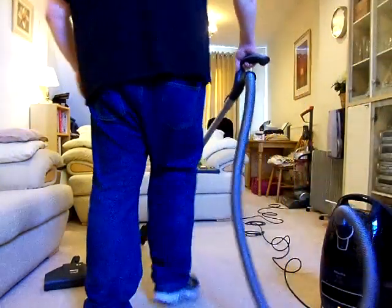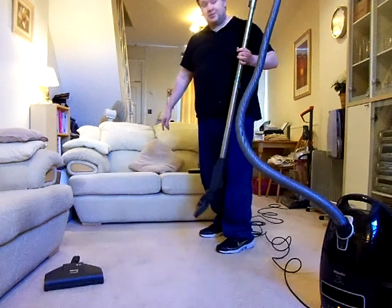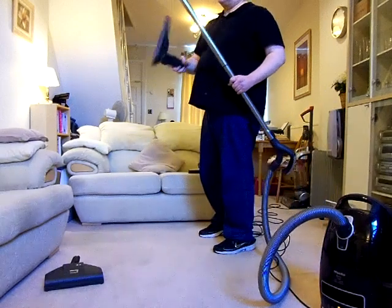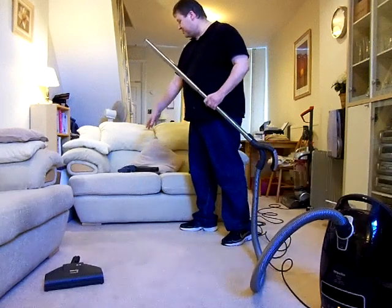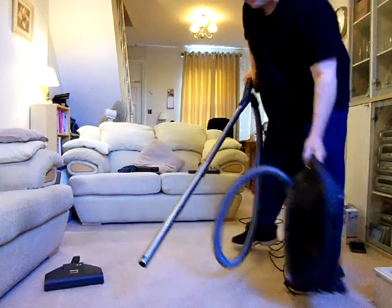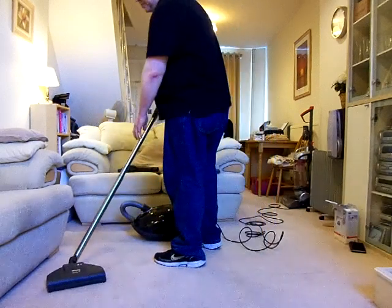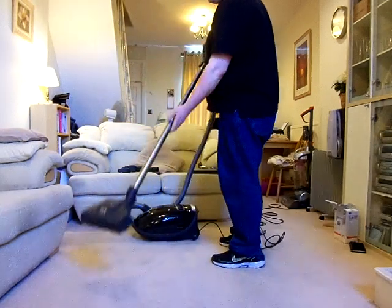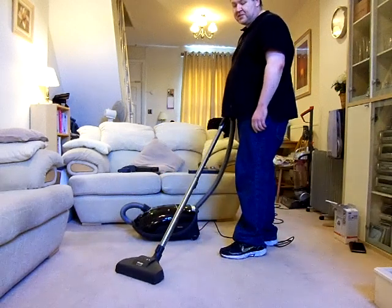That's quite a useful head, but I don't really use it very often because my carpets are always so clean the light would stay on green most of the time. Also, it's not a turbo brush, and I do prefer a turbo brush on carpets — while the Allergotech head is good at getting small particles of dust out, it's not brilliant on pet hair. Let's connect the turbo brush. With the turbo brush it's best not to use it on automatic suction, because the turbo brush creates a lot of back pressure, and that back pressure is necessary to drive the turbine fast enough.